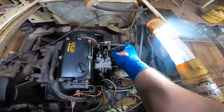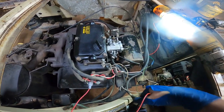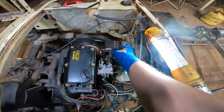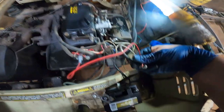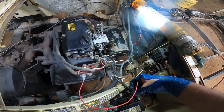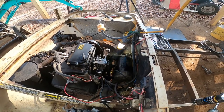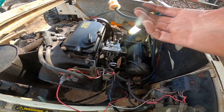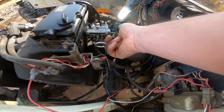And it cranks right up. Look how good it runs. I think I'm losing ignition because I only have it wrapped around here. Okay, so whenever I turn the engine off I hear like a slight hissing — like almost pressure still in the crankcase — and it also blew out a bunch of like water and oil and stuff through the breather hole. So let's go ahead and take this PCV valve off and see if it's clogged up or anything.